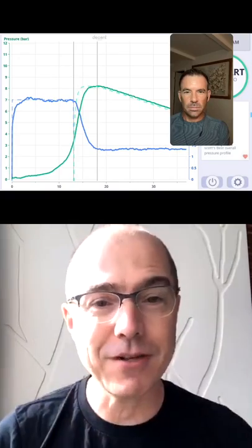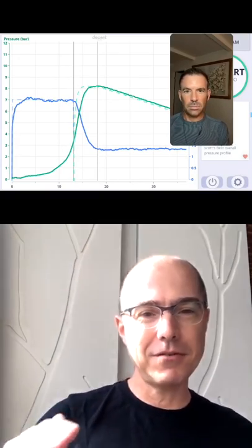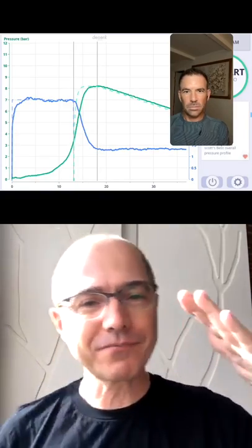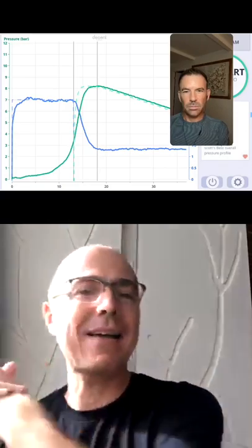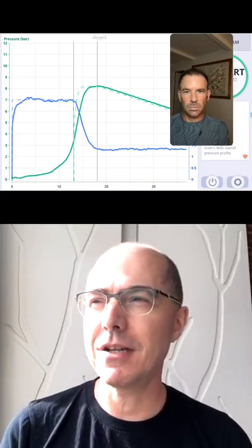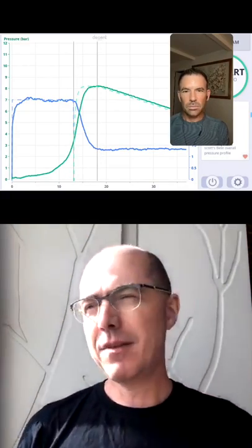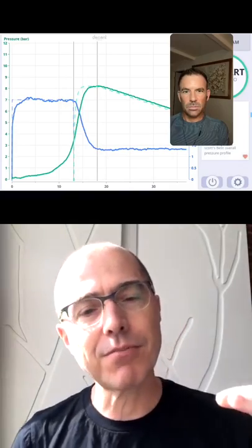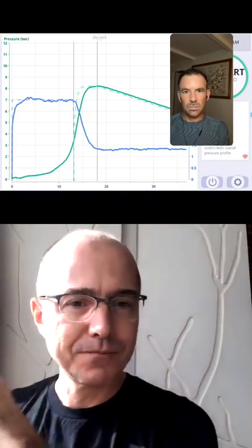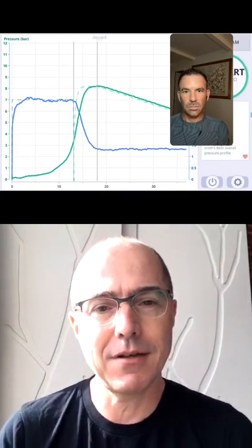Now, someone just said differential equation. One of the things we also do, though, is we used to essentially slam the puck with pressure. Like you say you want 10 bar, and we go whack, give it as fast as you can. And that would essentially cause the puck to super compress. And what we do now, we did about a year ago, is as we start to approach your goal, we back off and we gently approach the goal. Which turns out to be a lot nicer to the puck.